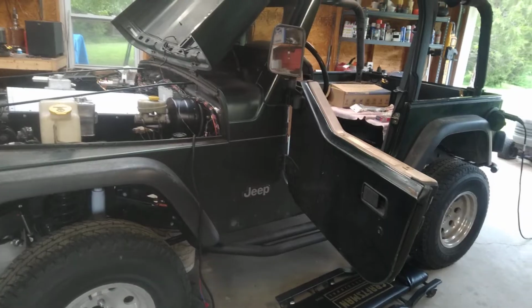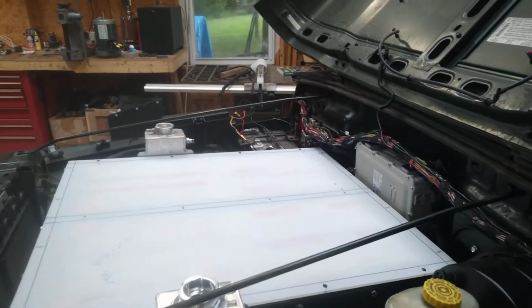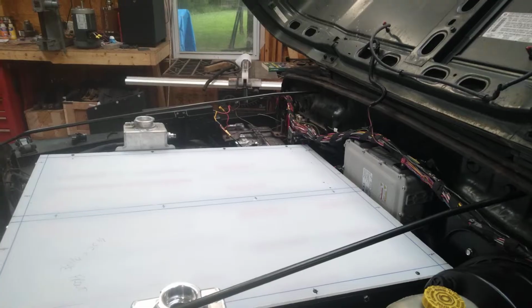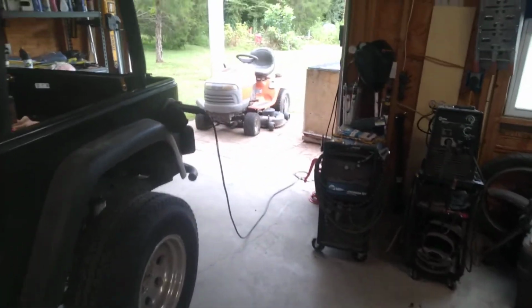So I could connect all my connectors into the Orion BMS and turn the ignition on and see what happens. As soon as I did that, all my dashboard and everything came up like it's supposed to. I took a voltmeter over to the 12 volt side and saw that it was actually charging. So that meant my DCDC converter was good. So that's fabulous.